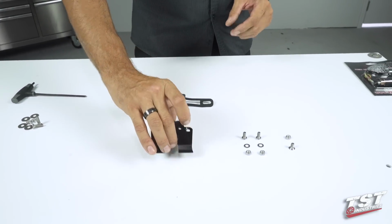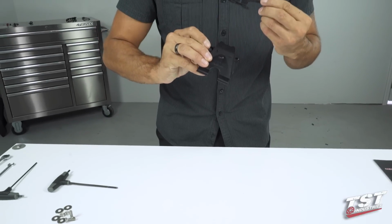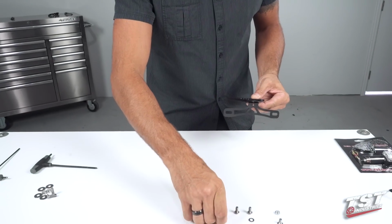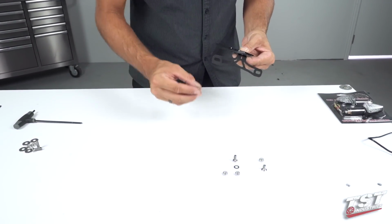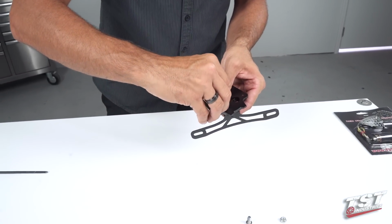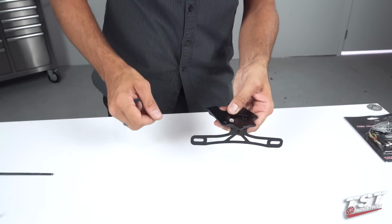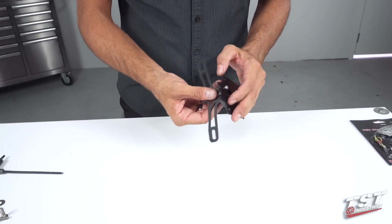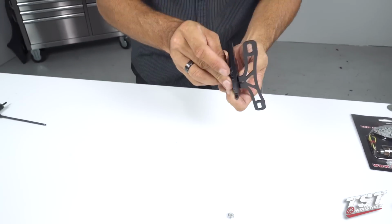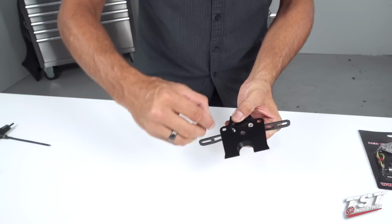We'll pre-configure this bracket onto the closeout, onto these holes on the closeout, like this, and using one small washer and one of these screws, fasten the bracket through the closeout, and on the other side it will receive the locking nylock nut. Once I get it hand tight, I will need to use a tool, but before that happens, I will just get both sides done. Make sure we get it in the right direction. The button head screws look nicer on the outside, so we left the nuts on the inside.